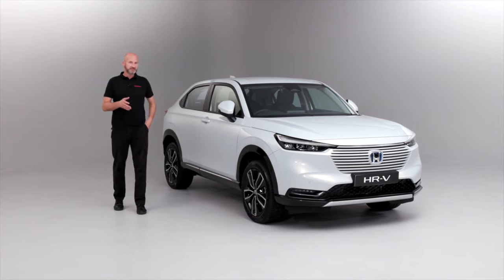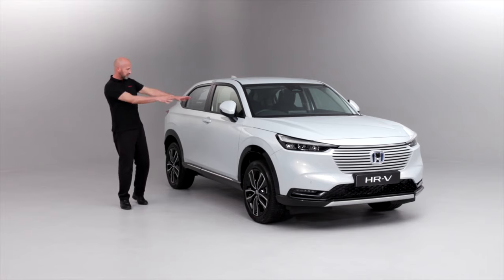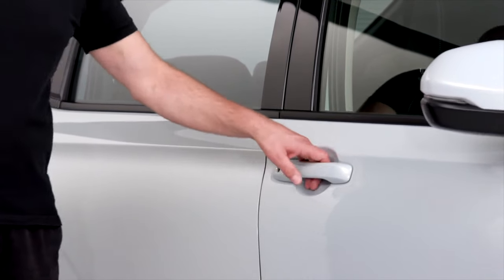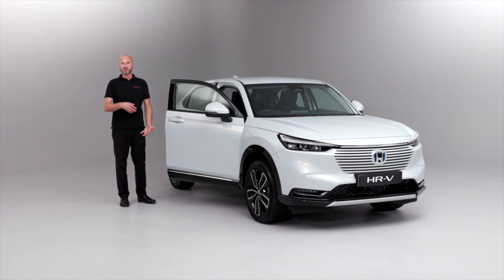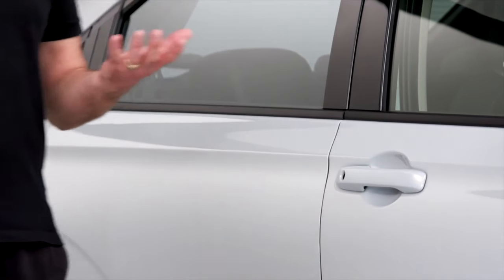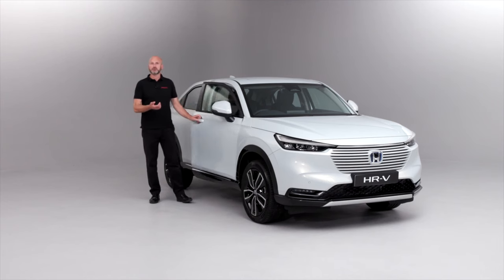Because the car benefits from the keyless access system, we don't necessarily have to have the key in our hand. The car is locked but I have the key in my pocket in the detection zone. All I need to do is put my hand in behind the door handle and you'll hear it unlock. You'll also see the door mirror unwind. So now we can get into the car without needing to take the key out of our pocket, handbag, or purse. To lock it we just need to put a little contact over those three ridges on top of the door handle. After about three to five seconds, as soon as I put my hand in it will unlock the door.